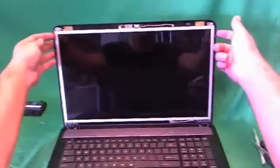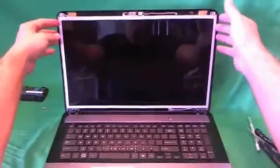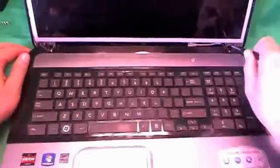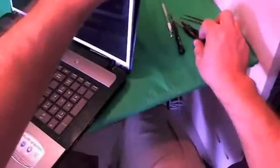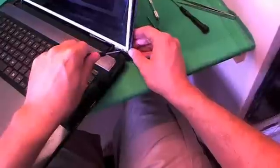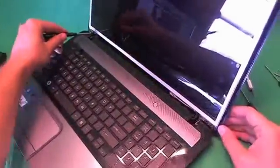For this type of screen, the screen is mounted by some screws to metal mounting brackets on the side of the screen, and we have to get to those metal mounting brackets. So that means we have to lift up the screen away from the screen assembly like this. There's a screw at the bottom that's kind of hard to get to, so one trick I use is to loosen up four screws at the bottom — two here and two here — that are holding the metal mounting brackets to the back of the screen assembly. Loosen up maybe one turn, not too much, just enough to get to the screws, and don't forget to tighten them when you put the screen back together. That gives us almost enough space to get to the screw on the bottom, so loosen a little bit more on this side and the other side.